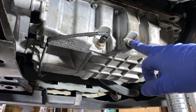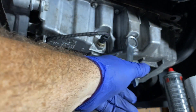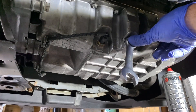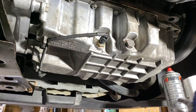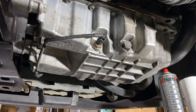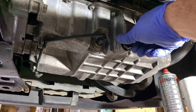To drain the oil, we need to crack off the sump plug. It's a 19mm spanner. Get it on there and give it a clout. There we go — it's cracked off now. I've got my bowl and we'll just spin this one off by hand.